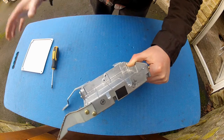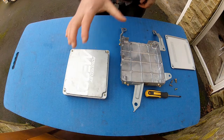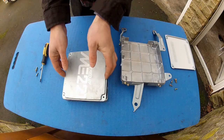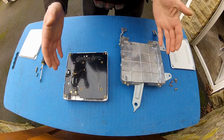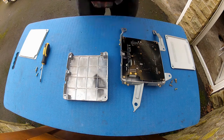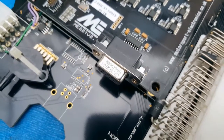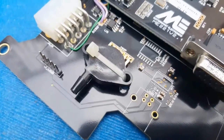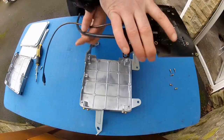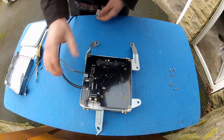Now that's done we can get the ME221 out of its case and install it into this one. The ME221 just lifts out and should fit straight in using the factory fasteners. Before I button that up, I need to get the tuning cable plugged into its socket and the MAP line plugged into the barb. With those two lines installed, the ME221 can be dropped into the factory case and if I've drilled the holes in the correct location these lines should just slot into them. Perfect.